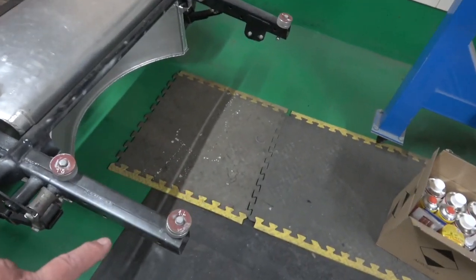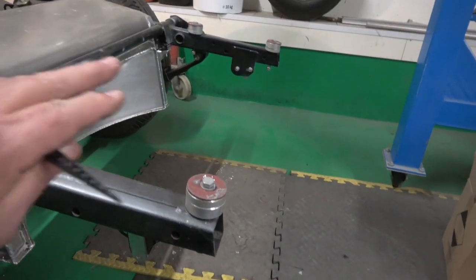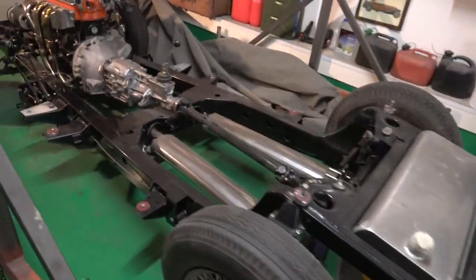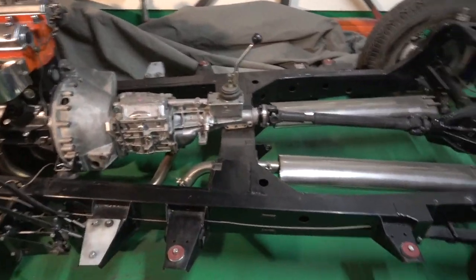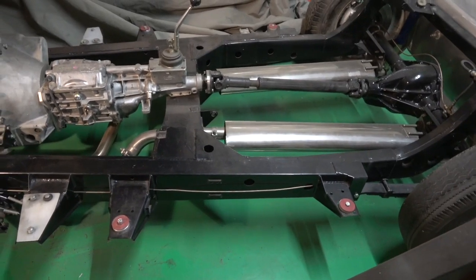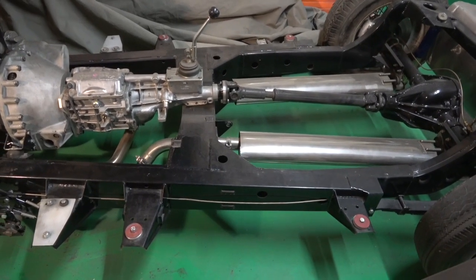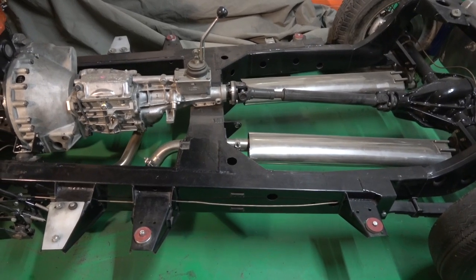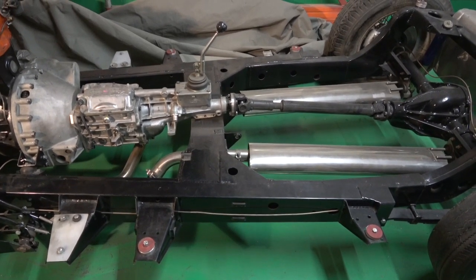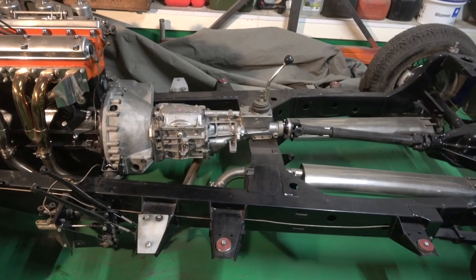The body has to sit on aluminium spacers — there's a special amount of spacers per fitting on the chassis. And along the chassis legs, they use a felt which stops metal drumming. I might change that because felt will likely keep dampness in it — I think I'll end up going for rubber stripping of the same thickness. We'll see. The rubber may be a bit harder, and the problem with the felt is I think it will hold water in it.